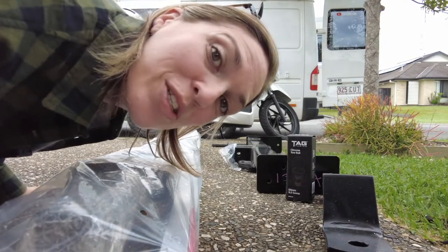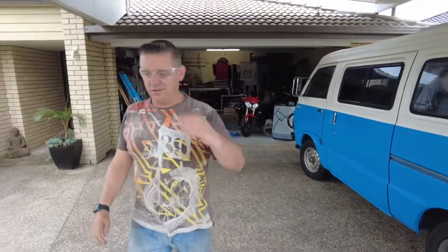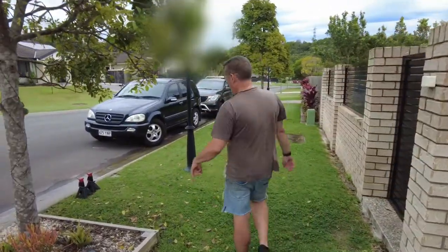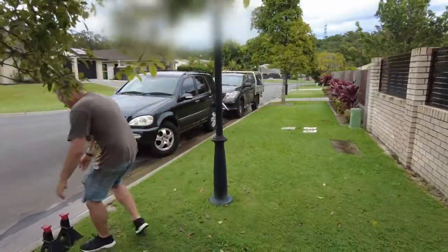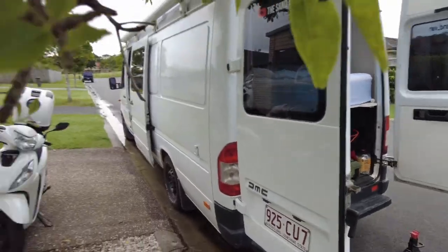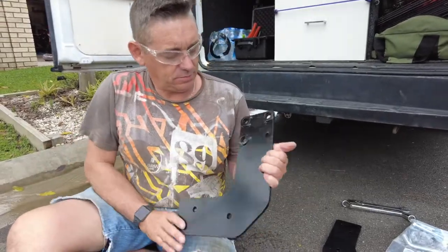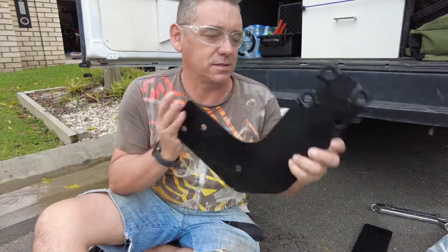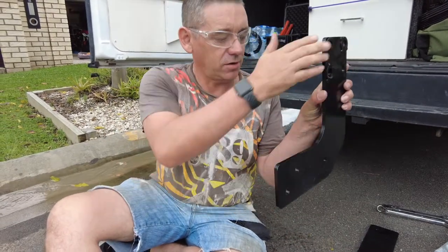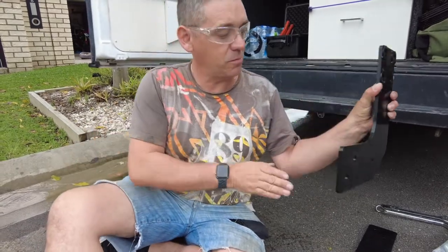Today, we install a scooter rack. Safety first. Every time we go underneath, I get dust in my eyes. A bit of metal. There. Oh, I just got smacked by this tree. First part of the installation is to fit these L brackets. These bolt underneath to the chassis, like so, on both sides, and then the main tow bar bolts to here.